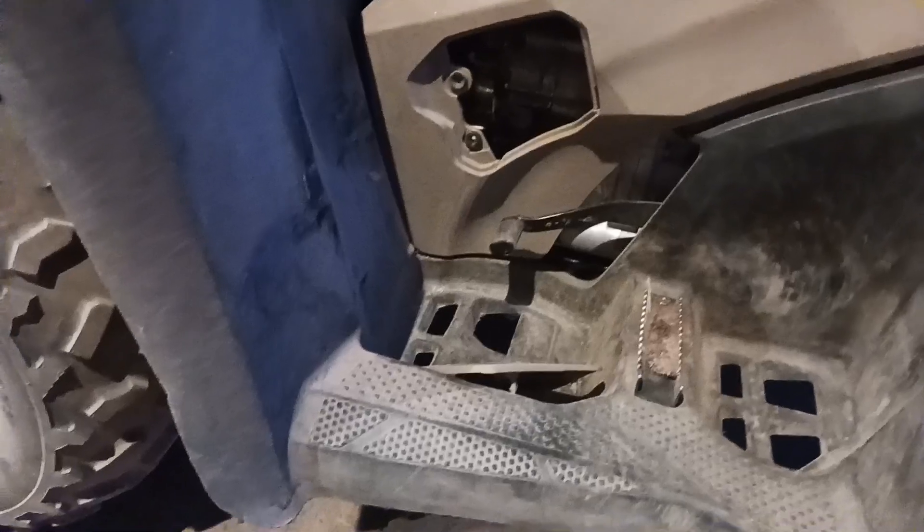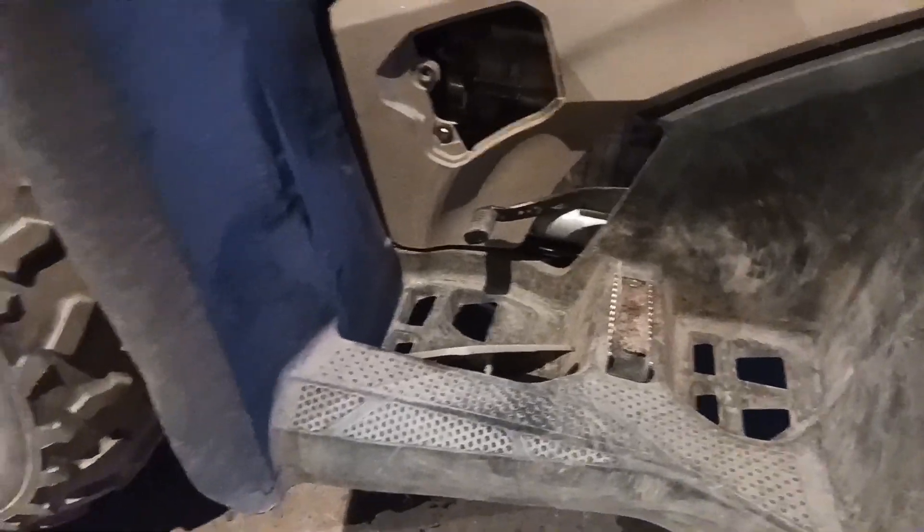It had been running for a little bit just to warm up the oil so it'll be a little thinner, not as thick. We're going to come under here — you guys probably can't see that — it's this hole right here, it's a bolt. We're gonna reach up in here and break it loose.